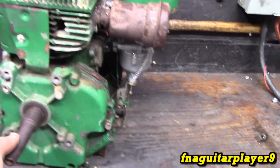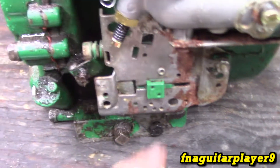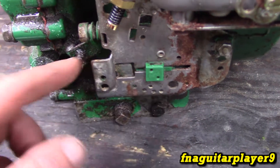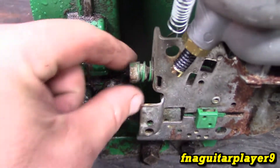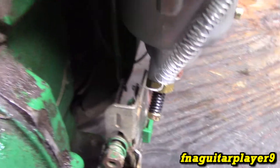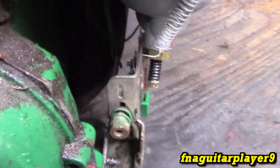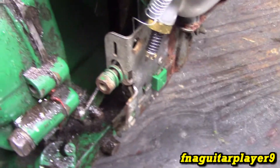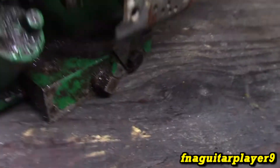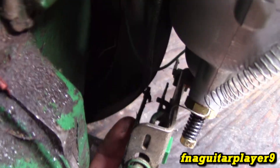That's more critical on a generator engine, so it's more critical to keep RPMs constant and your frequency the same. Your main throttle cable will connect to this, but in this case it has an adjustment here for fine-tuning on a generator to keep the RPMs and frequency constant. This just ties into the back of the piece that moves with the throttle. Your governor spring is going to be a little harder to see because the governor spring is actually missing on this engine — I didn't notice that. It'll connect between this tab right here and there will be a hole right here by this point.